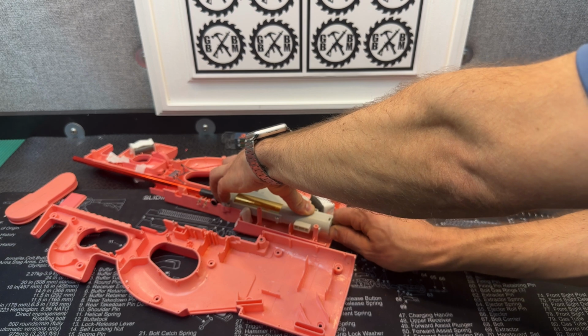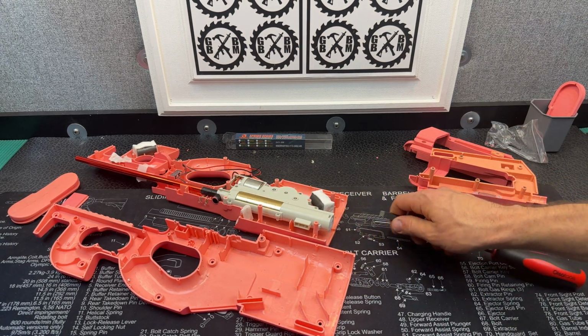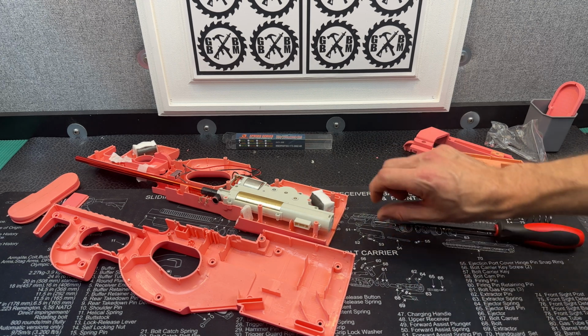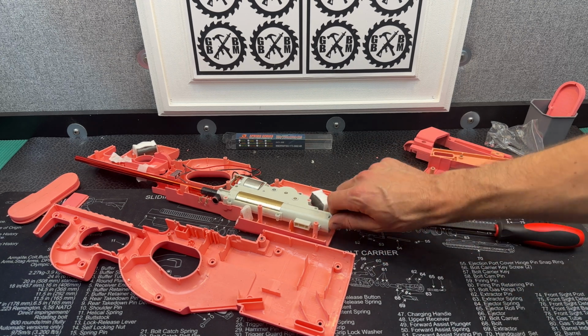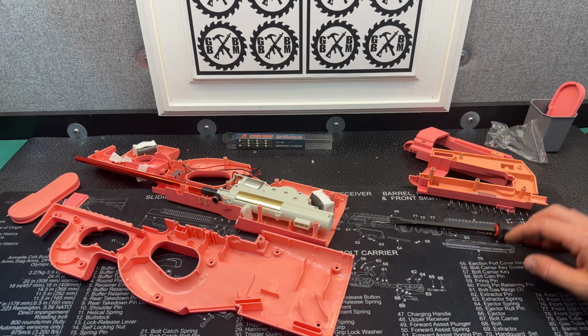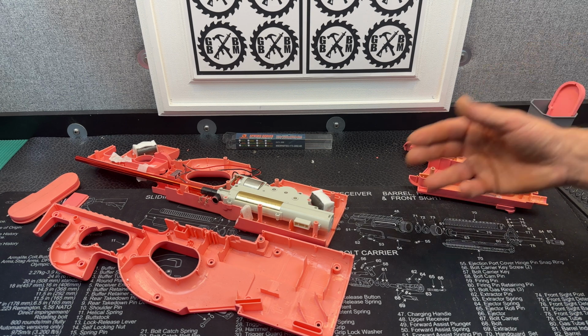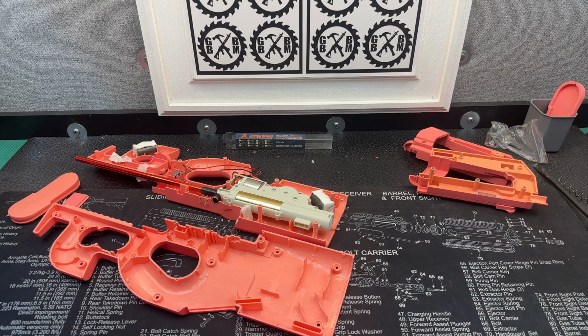Okay, and then you want to be able to turn it right there. So that worked out perfect. Sometimes I've been able to do it just with a thumb, but if there's too much pressure and it slips, then it pops out, and you've got to go find the spring and that little spring retention piece. All right, so it's quick, it's easy. That showed you how to do a spring replacement. That applies to changing the spring basically on any gearbox.